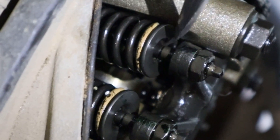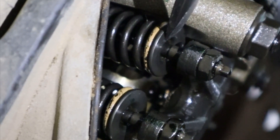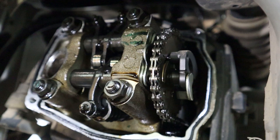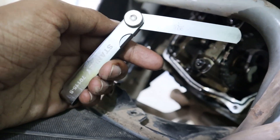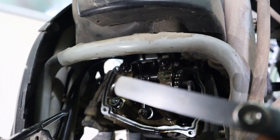The clearance is then to be measured between the rocker arm and the valves. The valve clearance for Aprilia SR150 is 0.08 mm on all valves. We will now measure the valve clearance of all the valves with the feeler gauge, starting with the 0.08 mm feeler gauge.